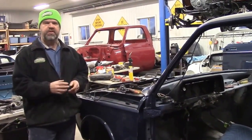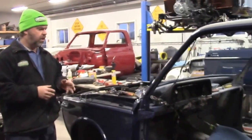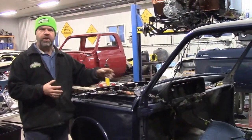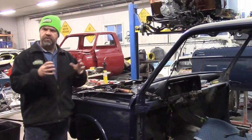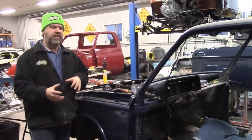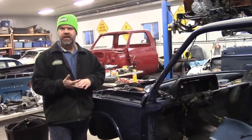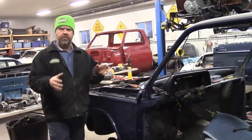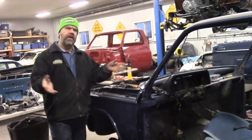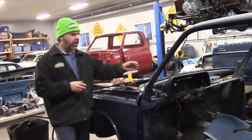We're not sure who that was and at this point it doesn't really matter. Our task is to make sure everything is working properly. The heater box was not working — there was a rheostat inside that was damaged. None of the components were properly working with the heater box, the ventilation, or the fan. So it was completely disassembled, everything was rebuilt, re-soldered, new wires put in, and then the whole unit was reassembled and installed in the car.